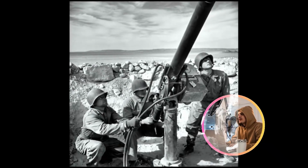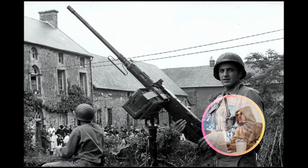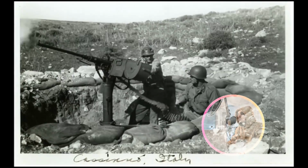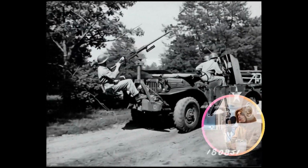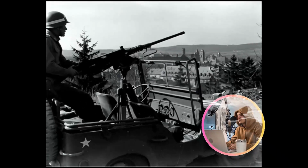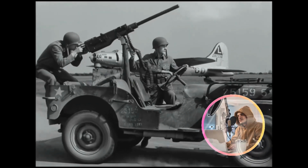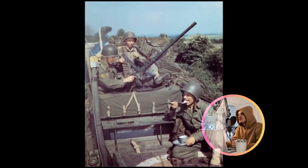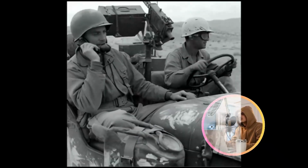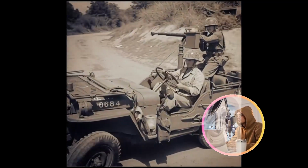Cupp meticulously cut the steel pipe into 4 distinct sections and welded them vertically around the base of the M31C pedestal, thereby fashioning a square protective cage. The lower end of each pipe section was securely welded to a steel plate, which in turn was bolted directly to the Jeep's frame. The upper end of each pipe section was welded to a second steel plate, which served to support the pedestal itself. Between these 2 plates, nestled within each pipe section, Cupp ingeniously installed one of the salvaged compression springs. Consequently, the pedestal now floated on 4 spring-loaded columns instead of being rigidly affixed to the frame.